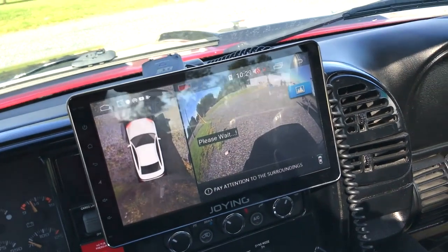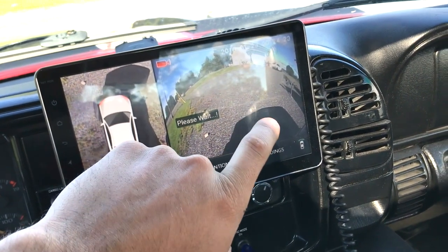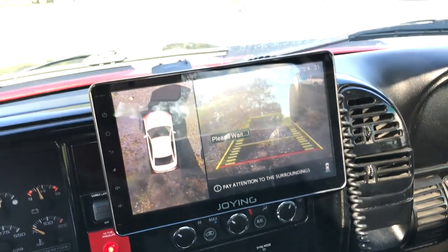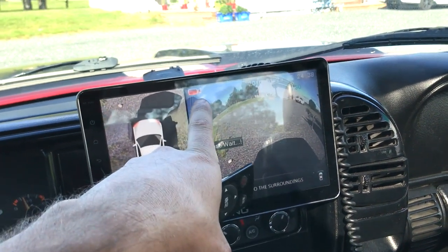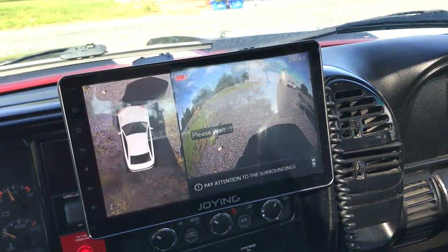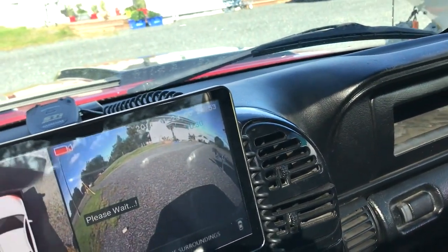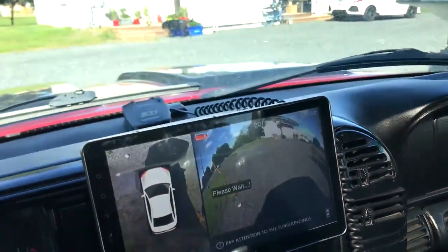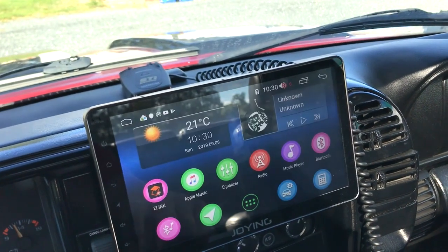I actually have a bird's eye 360 view — it's a separate system. Right now it's recording the front all the time. When I'm driving anywhere, it's recording the front. If I want to see the back or the sides, I can switch to those views. See the recording sign — it's always recording. When I'm in reverse, I set it up so it goes to the back camera. And if I put my signal light on, I could technically trigger the left or right camera. But I didn't want to go that fancy because I'd need relays due to polarity issues — the vehicle uses ground switching instead of positive switching.